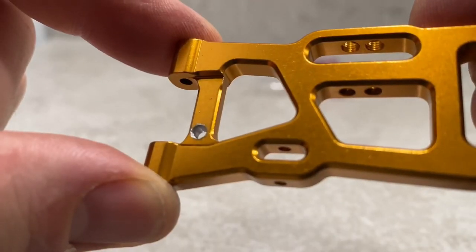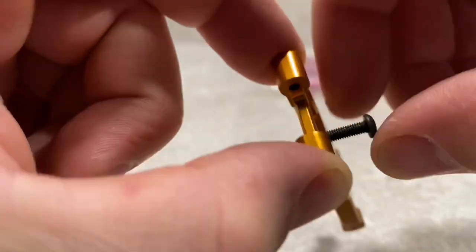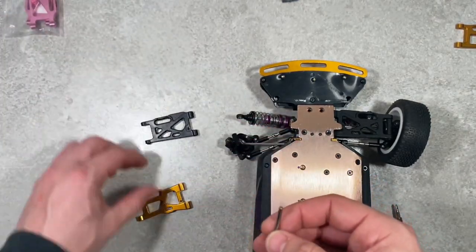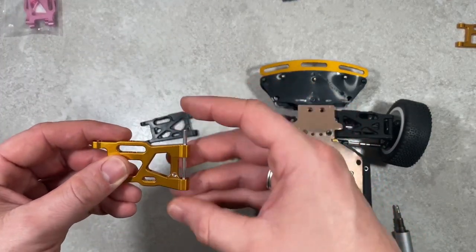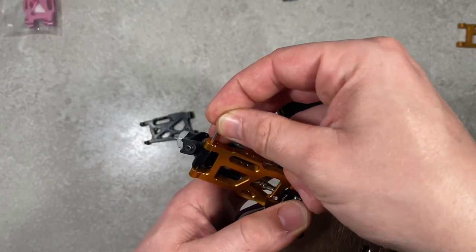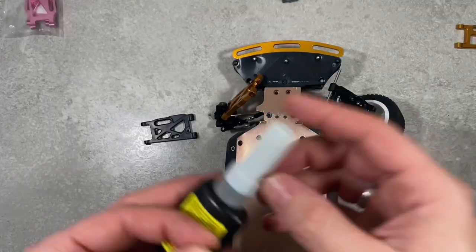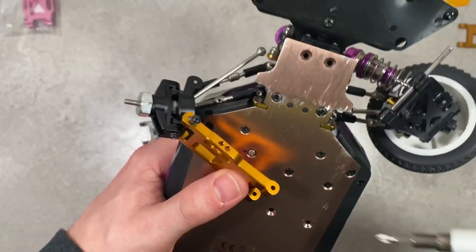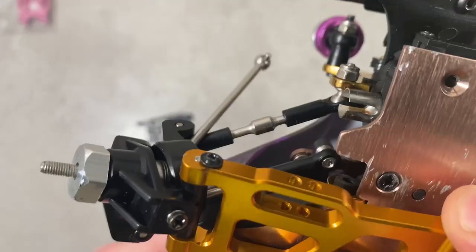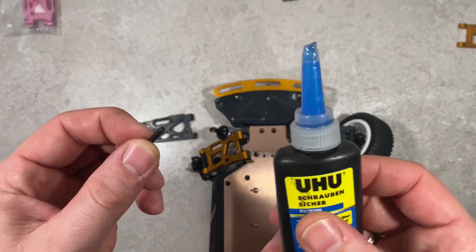It's no big deal if you have a tap. The big pin goes into the new arm to the other side, and the smaller pin to the left side through the hub. I would highly recommend using Loctite for the thread — when you put metal screws into metal it's always the best solution, so you're really secure.